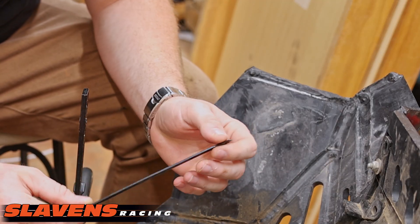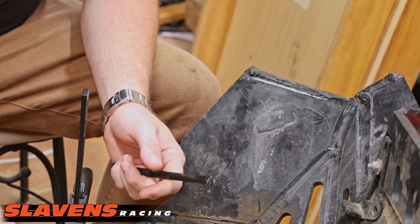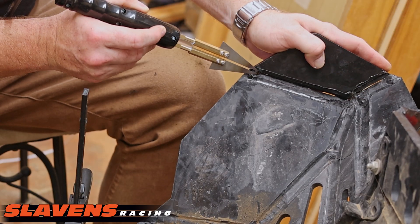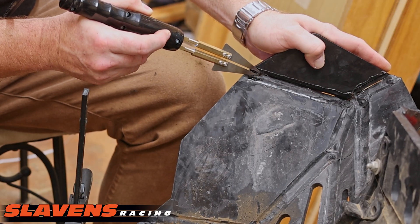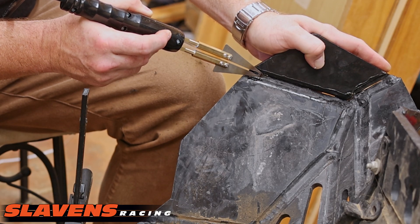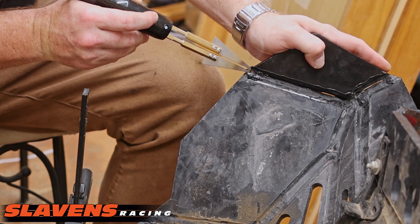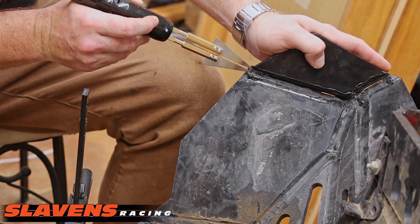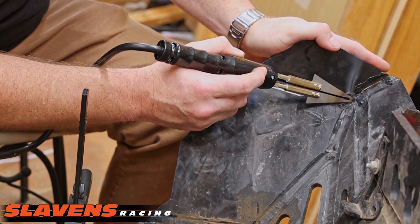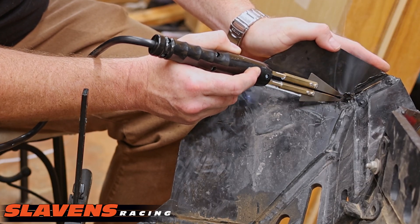It is polyethylene so you can get it off Amazon. I want to get as close to the same material as I could. Essentially what we're going to do is put this in place — you can see it's melting the actual polyethylene skid plate material as well as the filler that was used, and we're just going to keep pushing it in until it looks fused pretty well, then go to another spot and see if we can fuse it again so we've got a good area to work off of.